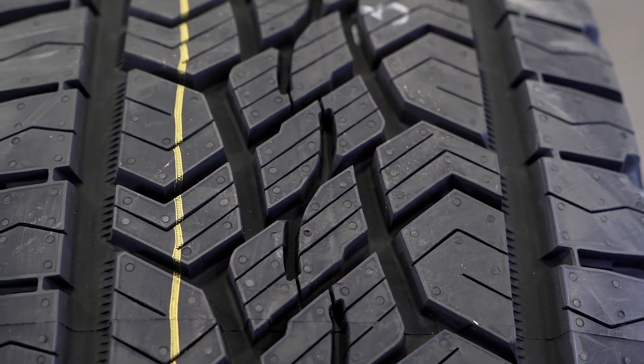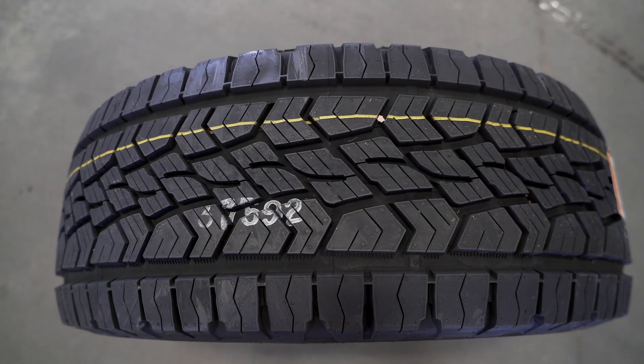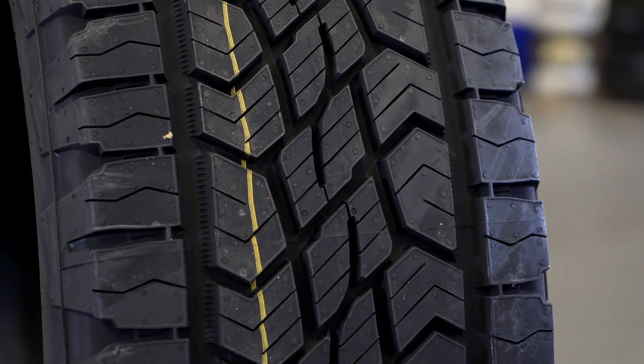Another cool thing about this tire is that they have a technology called Traction Plus Technology, which is a special tread compound proprietary to Continental. It's called Plus Silane, which is basically a silica-based compound. That's really what helps you in the rain and in the snow — it makes it grab a whole lot better and also helps it stop faster. Compared to something like a Michelin LTX AT2, this tire would stop way faster. In some cases, I've seen it tested and it's been over 25 feet shorter stopping distance in the rain. That silica really helps the adhesion to the asphalt and helps it perform like that.